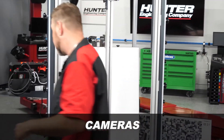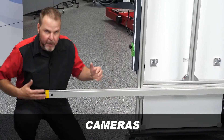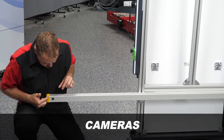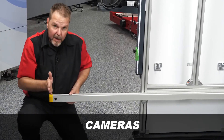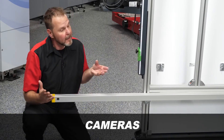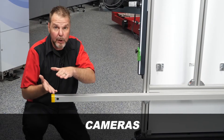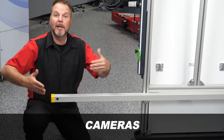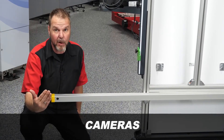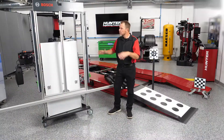Next, let's look at the cameras. These cameras look for the rear reflector boards that clamp onto the rear wheel, and they will line up accordingly. The ADAS Link will tell you if the angle is off and whether you need to adjust the plate on the rear wheel. This is what the cameras look for when doing the calibration to develop the center line and the distance requirements needed to properly perform an ADAS calibration.